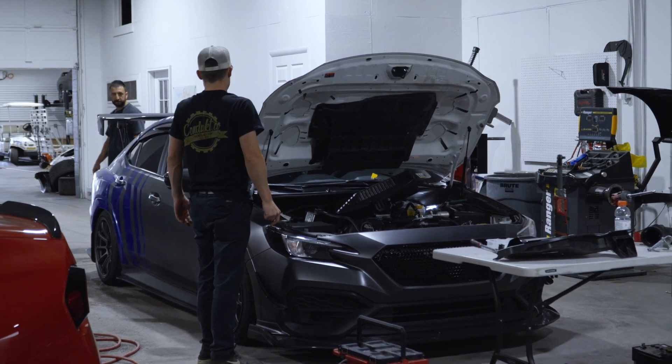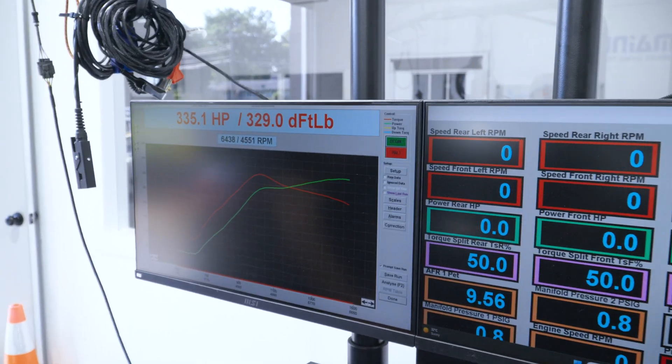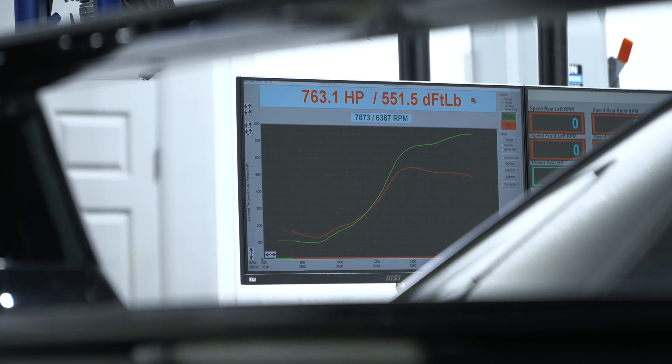Direct injection is probably the Achilles heel of the VB WRX currently. A lot of tuners are saying they're making big numbers with upgraded turbos using the factory fuel system. I'm going to be honest — I don't think they're making 600 horsepower plus. We have a Mainline Pro Hub dyno, and a local customer came by with an ethanol VB WRX. We tuned it and were pretty much maxed out at E60, making numbers in the mid-400 range. Our Mainline dyno has no correction and can't be manipulated. I think a lot of the 600 to 700 horsepower numbers you're seeing for the VB on factory fuel just aren't accurate.